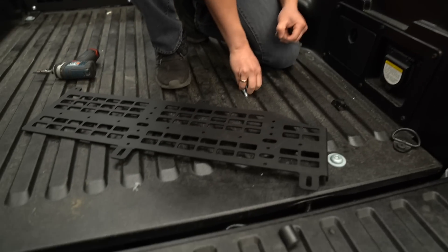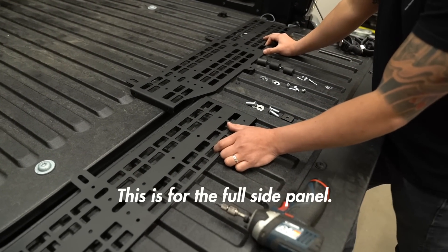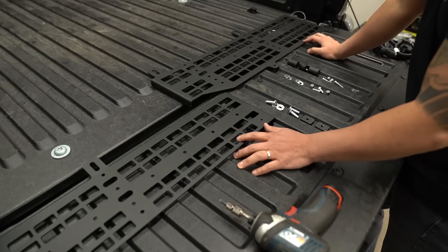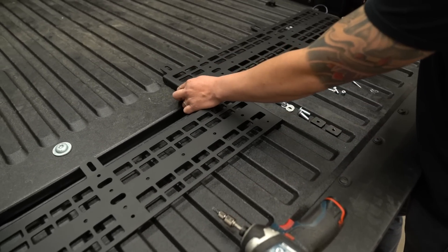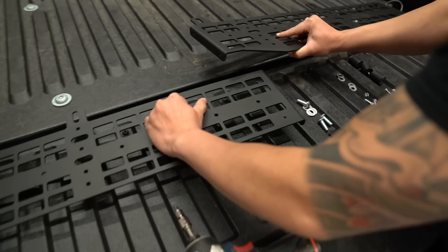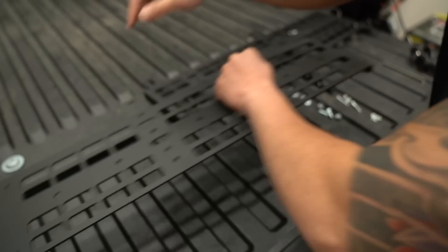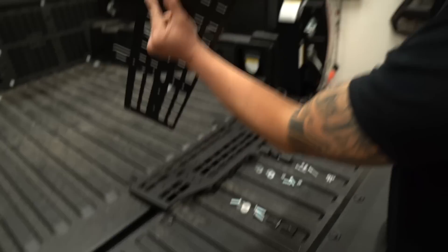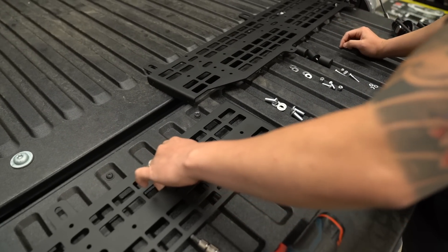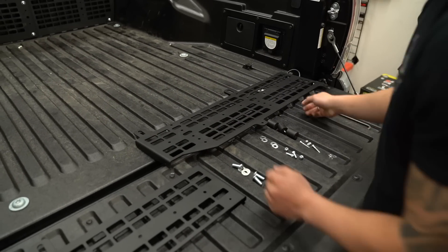But today's video, we're going to do the full installation. For the full installation of the side panels, we're going to have two of these side panels. The easiest way to pair them up is to look for the bend — where it bends down. Grab another piece, the front piece, that will have the same bend. If you have one with the bend on the wrong side, it won't work because you're going to have two screws that need to go into each other. For the full system, that's actually the first step — attaching these two side panels together before installing onto the bed itself.